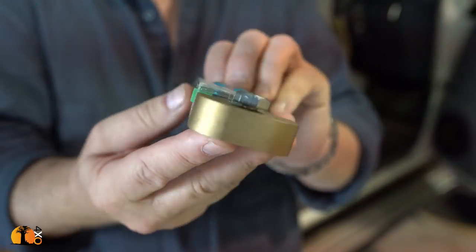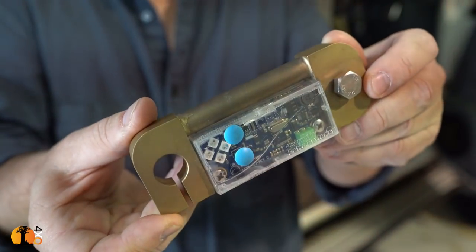I tried an experiment with these batteries — I wanted to push them to the limit. What I did is just leave them draining lights and fridges until everything turned itself off, including the LED lights. You can see it going dull and bright — that's the LED not managing to get enough current. When a battery is so weak that an LED can't cope, the battery is flat. Normally if you discharged a battery this much you could potentially destroy it — it would just not accept any current. Lead crystal is supposed to handle deep discharge very, very well.